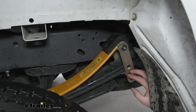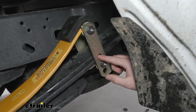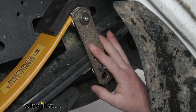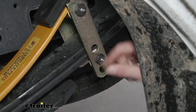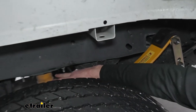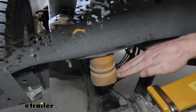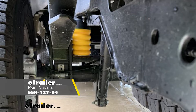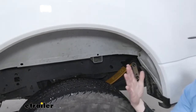We have three different holes. I'm using the middle one because it's the middle ground. If we have some heavier loads, we can use the upper hole to keep it a little bit closer, and if we have some lighter stuff, we can go down to the bottom. Another way to enhance your suspension is by replacing the factory bump stops — the ones we sell are a little bit bigger, but you're not really getting any suspension enhancement right off the bat; it's only when your suspension sags enough that those bump stops kick in.